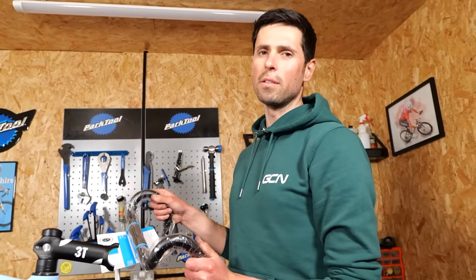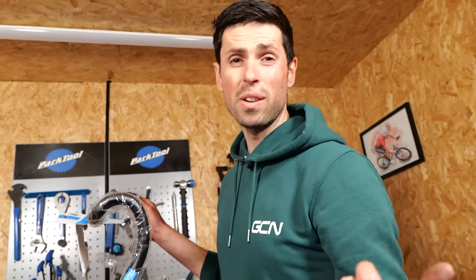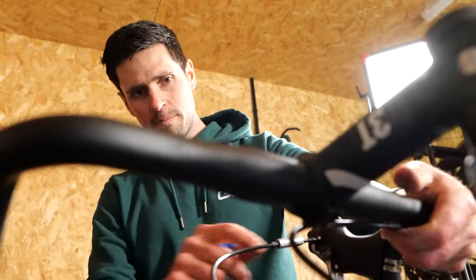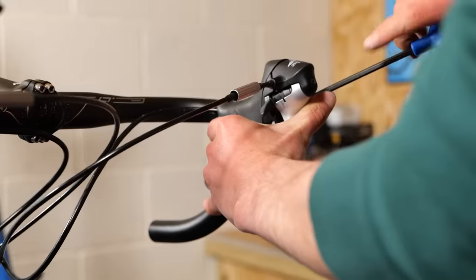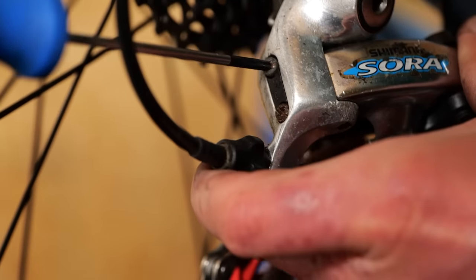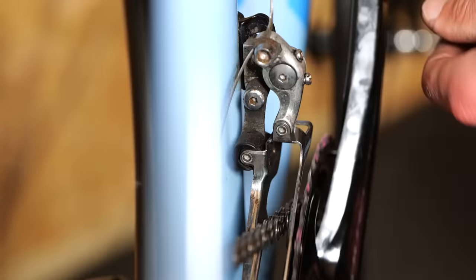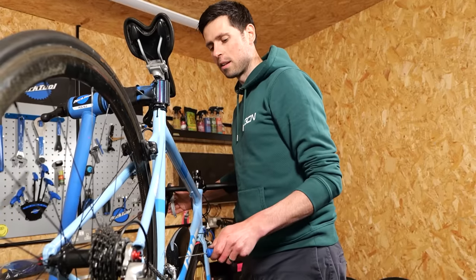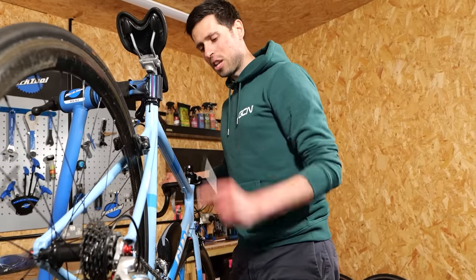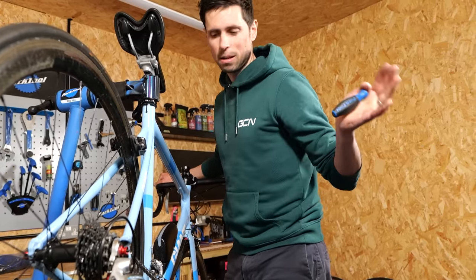We're onto what is a job I've been itching to do since episode two of this bike build series, which is getting this really annoying rustly cellophane wrapper off of these handlebars. I tried to do it in episode two but Stefan told me he wasn't allowed to do it. I can't decide whether to set the limit screws on the front derailleur to work for the middle and inner chain ring or the middle and outer chain ring, because obviously it's got a triple shifter on the front. I'm going to go for the inner and middle position on the shifter and set it up for that.